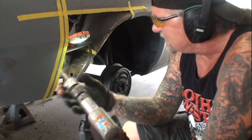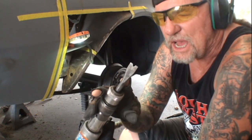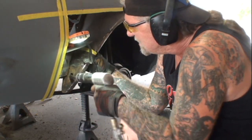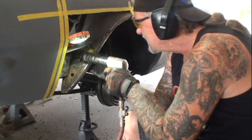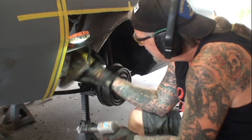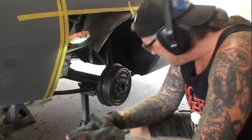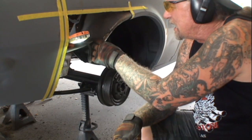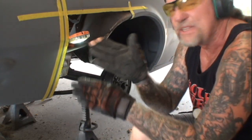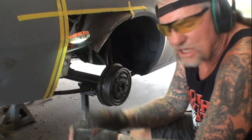I'll go ahead and take my air chisel and try to find the spot welds. Using my spot weld buster — this is not your regular average air chisel bit. If you don't have a spot weld buster bit, don't try this at home. And there you go, just like that. The next thing I'll do is transfer my measurements onto the other panel, get it welded in, and clean my metal up really well so we get a nice good weld. I'm going to weld it on the inside and the outside for a nice solid fit, then grind it down nice so it looks like factory original when we're done.